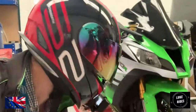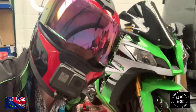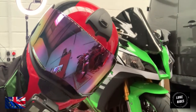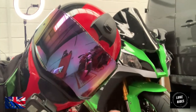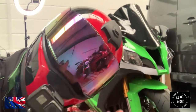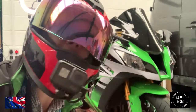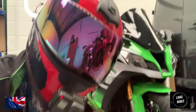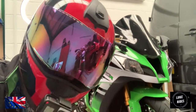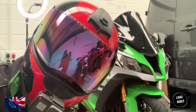Even our brake discs. Stunning. What you're about to learn here today is quite an interesting video, because we're about to take the existing factory Kawasaki Superbike brake discs — they've actually hit the 4mm limit and need replacing. Instead of just replacing them with the factory discs, we're upgrading to EBC Superbike brake discs for the ZX-10R.